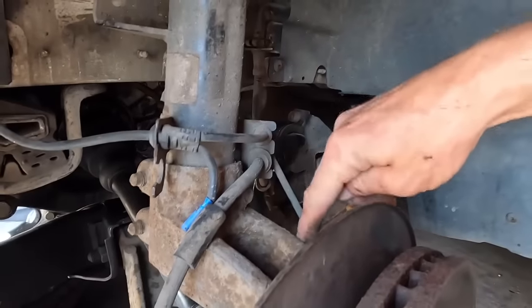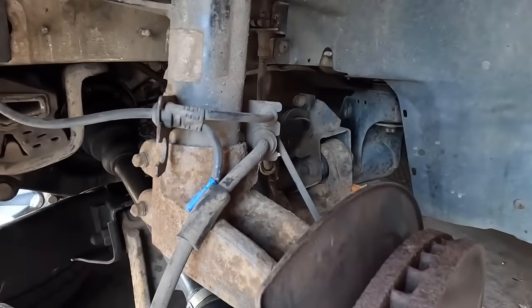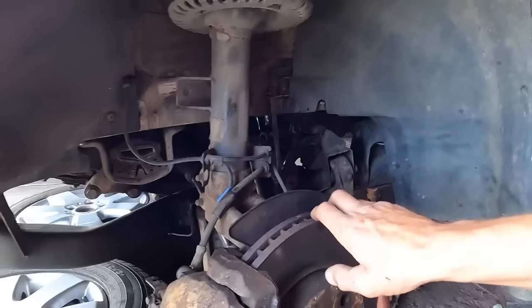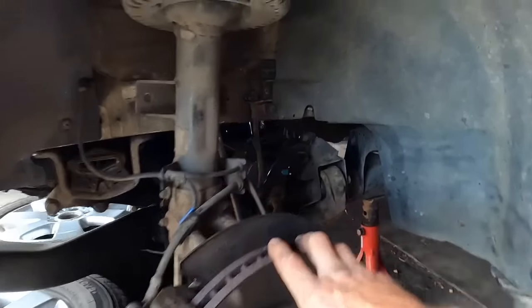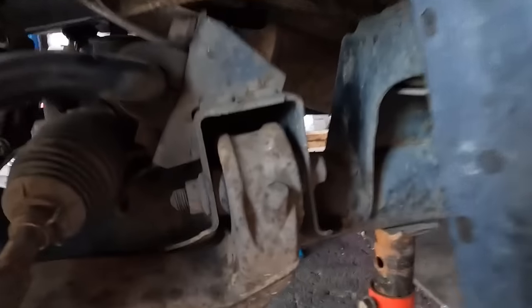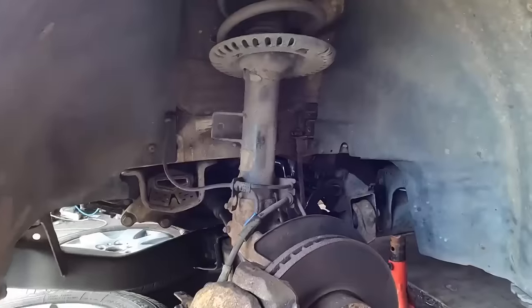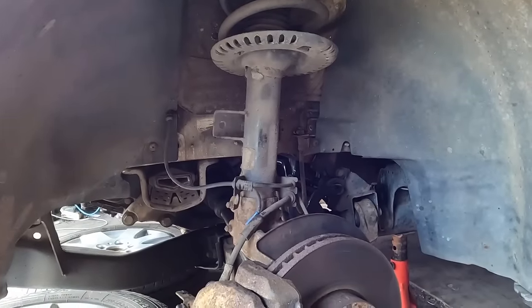Rather than just beating these two top surfaces and making your hub look unpretty, you can get them apart a lot easier. Anyway, we need to get all this off. Wishbone, we've got some 21mm nuts and bolts, front and back. We've got some Torx bits on the ball joints. I have already stripped one side down, a bit like Blue Peter. Here's one we made earlier.